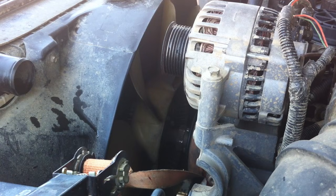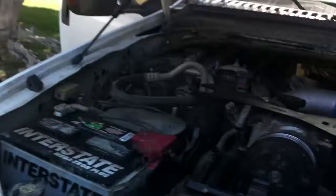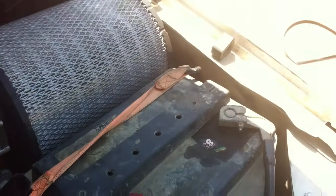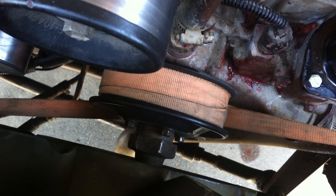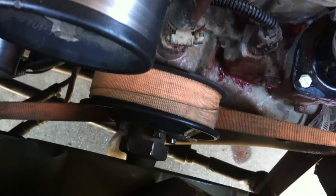It's been about 40 minutes since I last recorded the last clip. That's when I told you to take the clutch fan off, and I finally got it loose, so I'm going to show you what I did. I got this idea from someone on FTE who recommended it to me. I took a ratchet strap, tied it off over there to the fender opening and over here in some hole in the front of the truck. That's holding most of the tension on the pulley — it will spin on its own if you just grab the clutch fan nut, so you're not actually getting anything done, but it takes a lot of the work out of it.